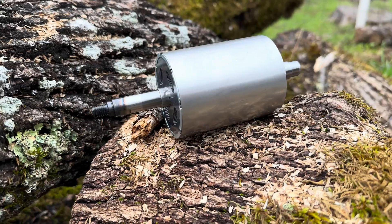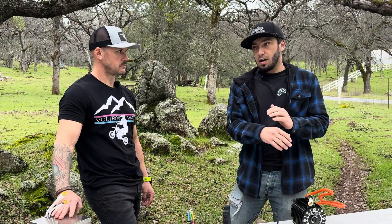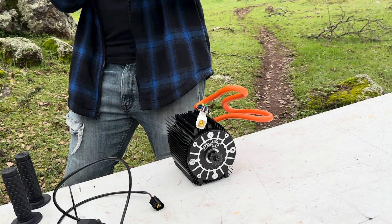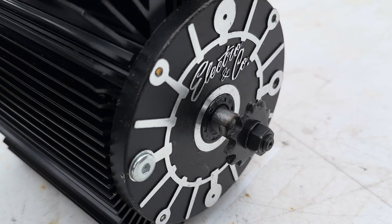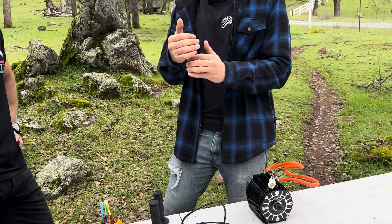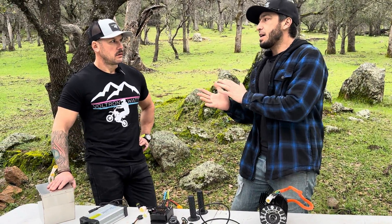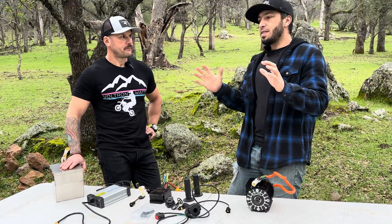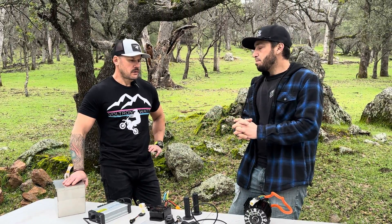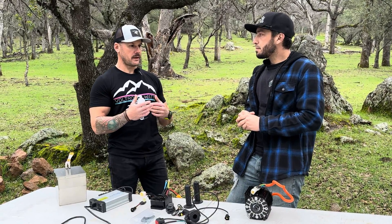In the V3, there's a stainless steel band on the rotor that holds the magnets in. Magnet delamination wasn't a huge issue before, but this allows the motor to spin at 9,000-plus RPM without any worry. They've also hardened the shaft. The goal with the EC4P in general was to keep the same double-D bore that everyone has been using, while reducing failures that occurred when running 11 to 15 kilowatts through it — especially under abusive conditions.